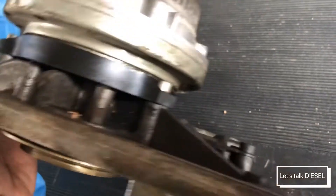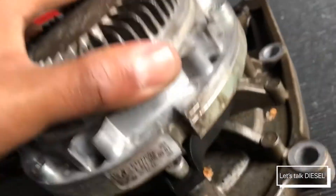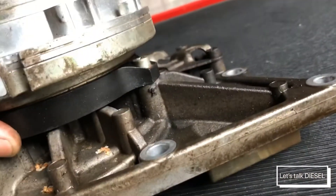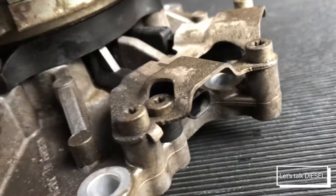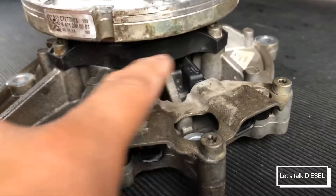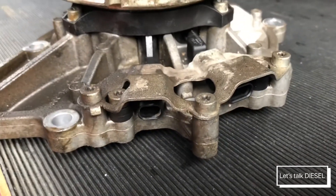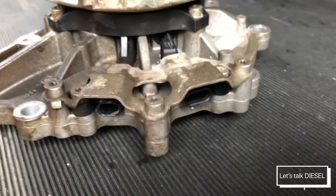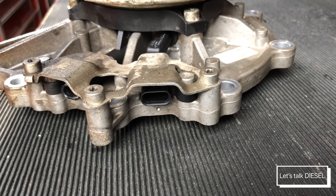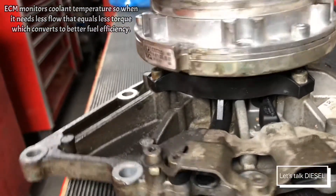I see there's a plastic part down there. I've already replaced these water pumps before — they are more than a thousand dollars right now because the trucks aren't that old yet. That part rides a lot but you still have the same coolant leak issue as the older ones. They just installed the clutch on top and called it a new water pump. This one has two sensors — one is a speed sensor related to the water pump, and the other one controls the clutch. That's the thing that helps save fuel, because if the coolant doesn't need to flow as much, the computer controls it that way.